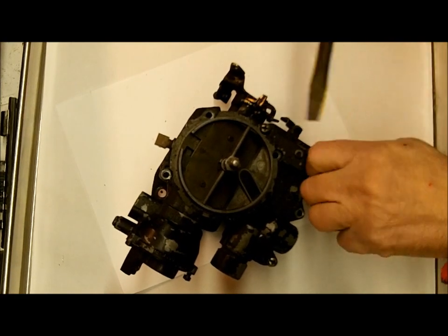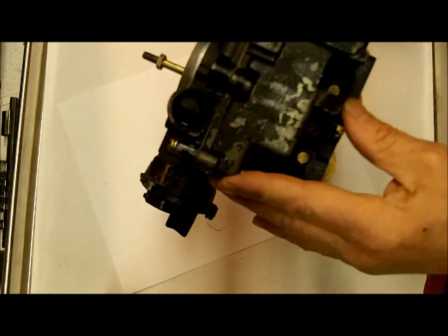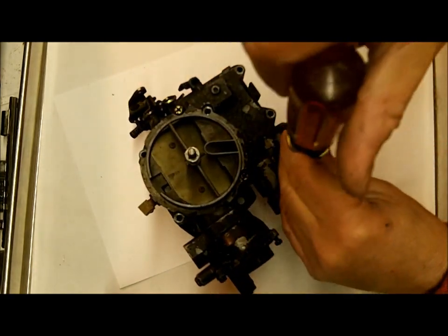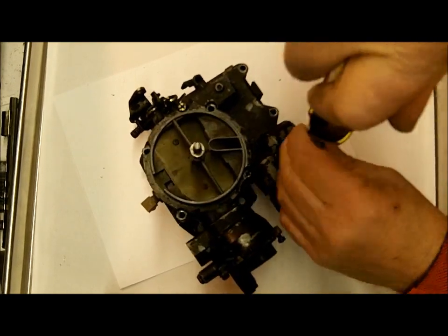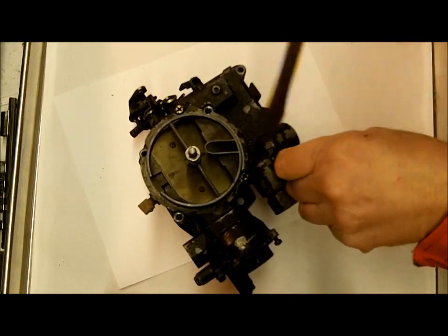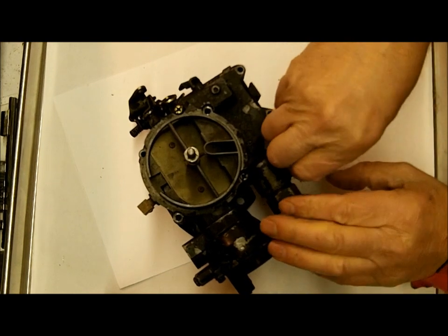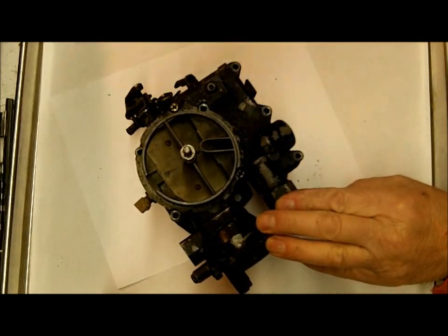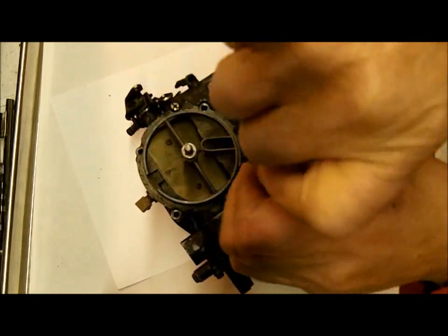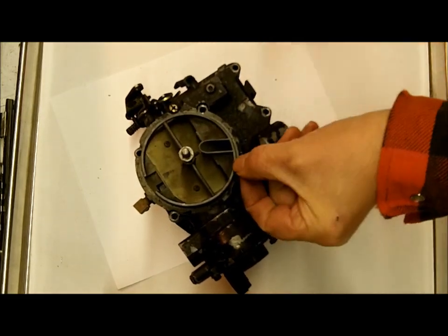The tag got ripped off here, but once we get it apart it will be easy. I don't think these have a number stamped on them — they normally have tags. If you don't have a tag, on the marine, going by application is fairly safe. The carburetors on marine engines didn't tend to get switched around like on automotive. On automotive I never go by application — I go strictly by carburetor number. You just never know what's been done after 40-50 years on classic cars, but marine engines you can almost depend on having the right carburetor.